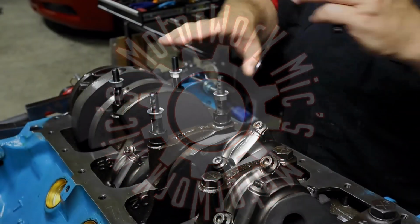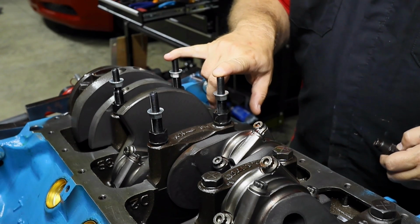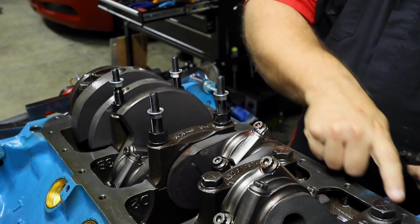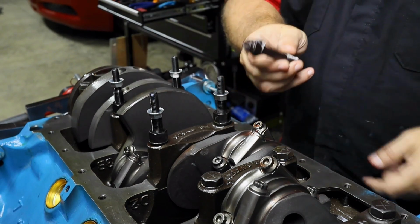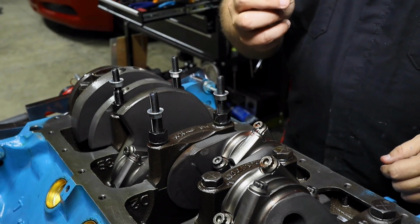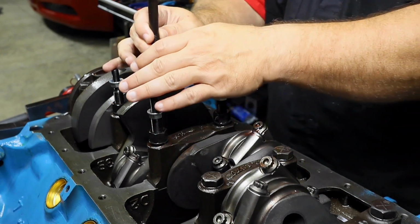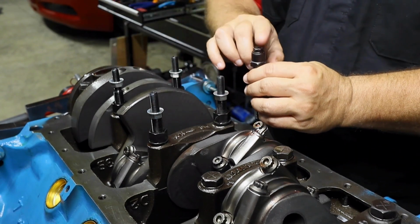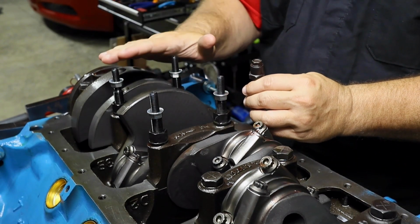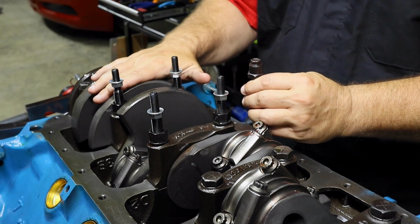Something's a little different here. Now, if you notice, gone from saddles 1, 2, 3, and 4 are the standard OEM bolts. And the reason being is because we're using a windage tray, depending on how you pronounce it, right? The standard OEM ones weren't going to work. And that is because of the amount of, well, quite frankly, stroke on the crank itself, all right?